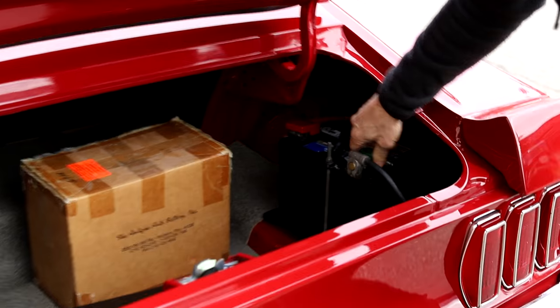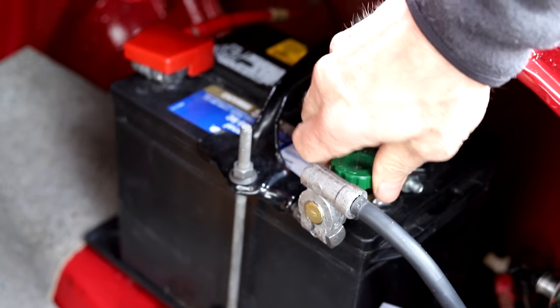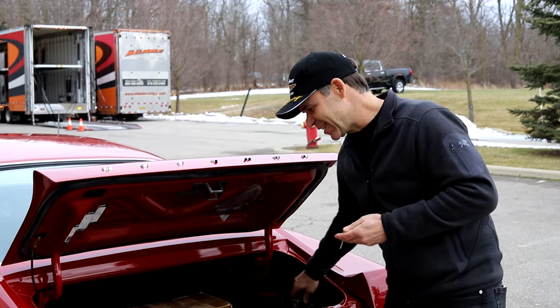One, to start them — and two, every car should have one of these. In the trunk, just a simple shut-off switch for the battery. With old cars, it's a great thing. Every time you shut the cars down, just put one of those switches on and undo it. If you had a draw, any sort of issue, the car is not gonna burn to the ground. For shipping purposes, the number of times keys are left on — if you make sure that when you ship it, after it's loaded up, undo the switch. Even if the guy leaves the keys on so you can turn the steering wheel, it's not gonna kill the battery by the time it gets to the customer.